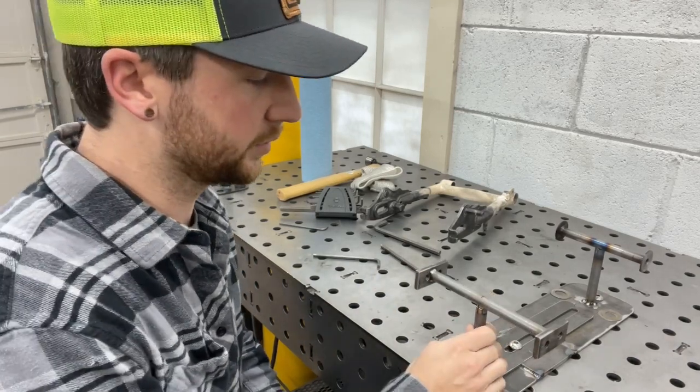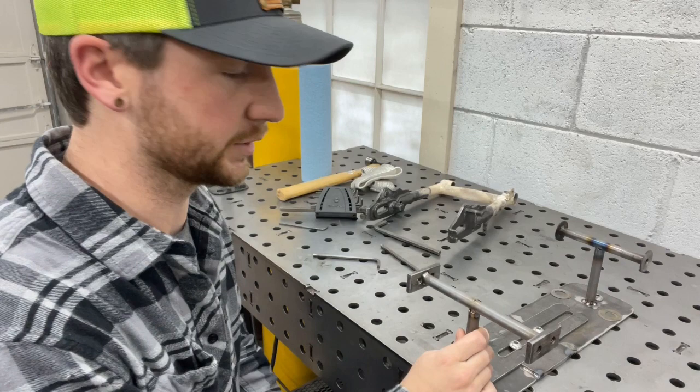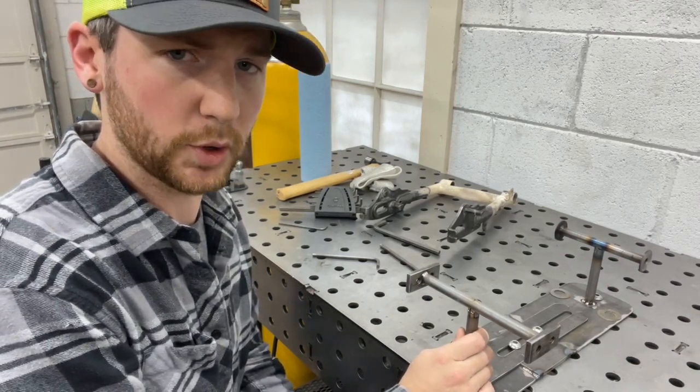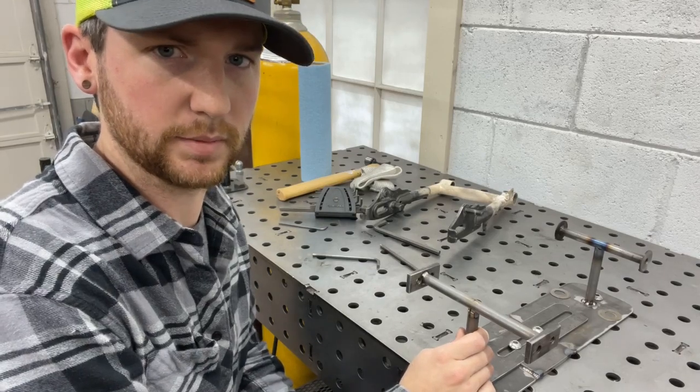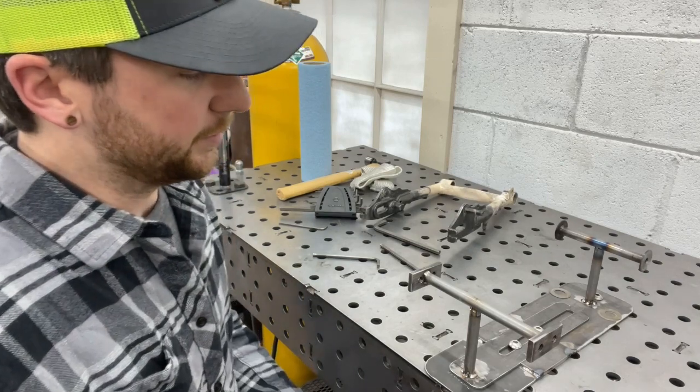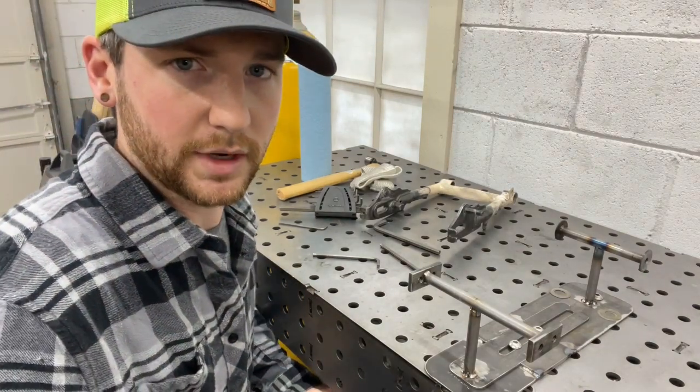And so, as I was building it and everything, the swing arm was mounted. I marked it, and then now I can cut the swing arm apart and extend it by 1 inch. I hope that all makes sense. If it doesn't, please let me know. But now we'll cut apart the stock swing arm and start building.